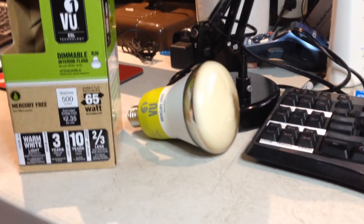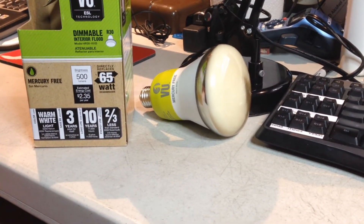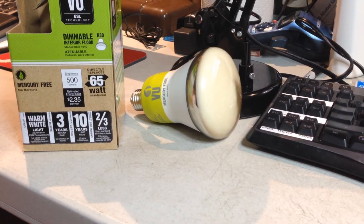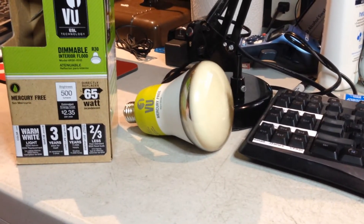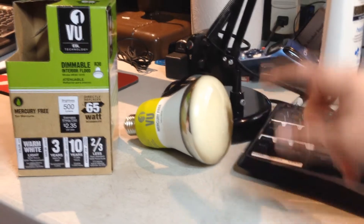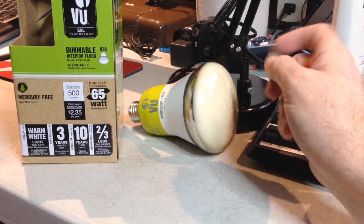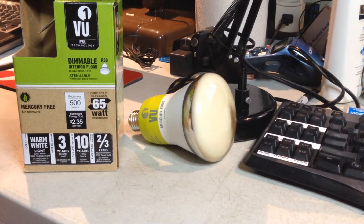What happens is basically — if you remember the old IBM monochrome white screen displays that you might find on a PS/2 or maybe an old 8088 — it basically uses an electron gun to scan and bombard the surface of this glass, which is coated with phosphor on the inside. And it excites the phosphor and makes it glow, just like a TV set.